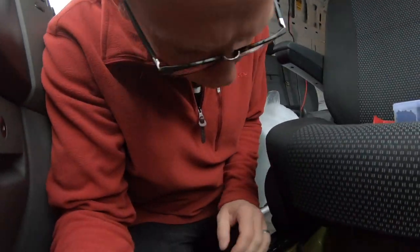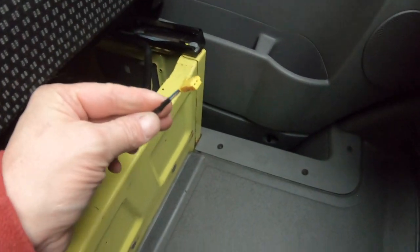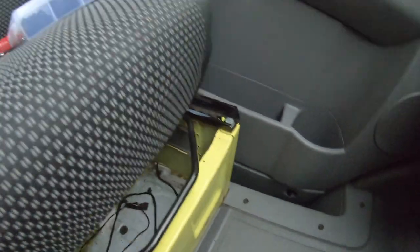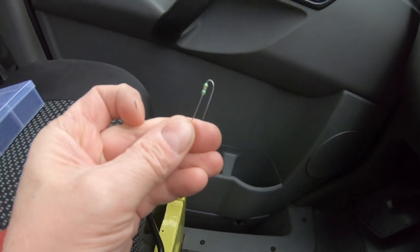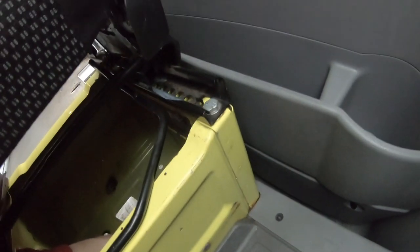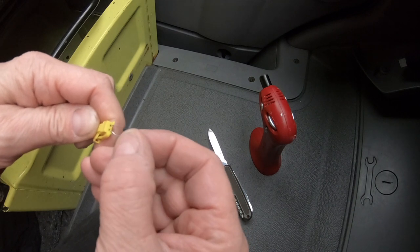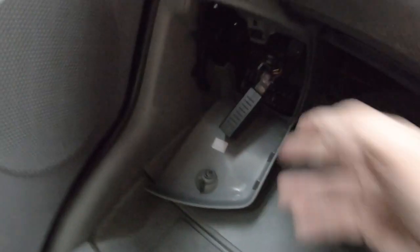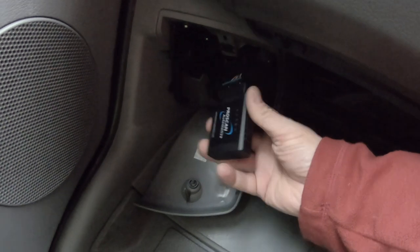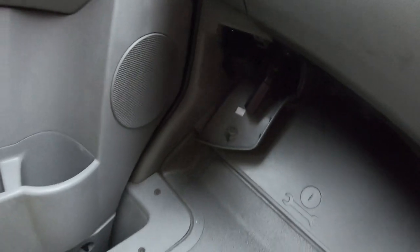What I've done is found the wire which was connected to the seatbelt on the old double seat, and after a bit of googling I found that if you take a 1.3 ohm resistor and connect it into that plug — the ends of the resistor in there, obviously shortened to suit — and then once that's together, through the OBD port I've got this connector which connects to an app on the mobile phone, which in theory I should be able to use to reset the fault warning.